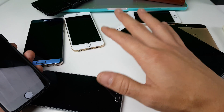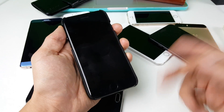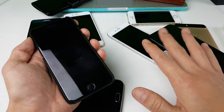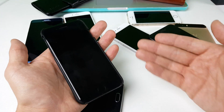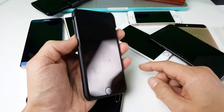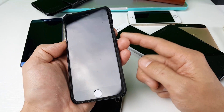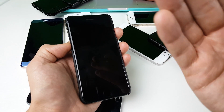Now, if you're familiar with all the other previous iPhone 6s, there was a combo where basically you can do a cold restart on the phone. The combination was two buttons — the home button and the power button. However, with the iPhone 7, because of the new home button, it's a different key combination. It's actually the volume down rocker and the power button. Now this phone's already fixed — let's just pretend that the screen is not working.